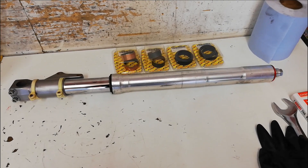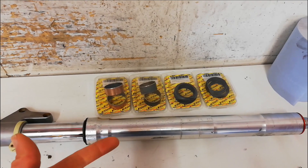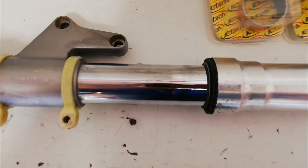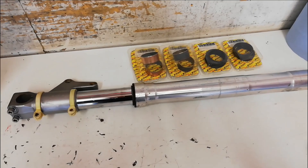The previous owner was very good and gave me a set of new fork seals with the bike. So we've now got a full complement of oil seals, dust seals, and new bushes - K-Tech good quality stuff, available from BNC Express which is local to me. The outers have got a little bit of tarnishing but should clean up. The chrome's in pretty good condition with a couple of really minor pit marks, and I'm just going to give them a light run over with an oil stone and they should be all right.